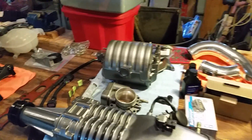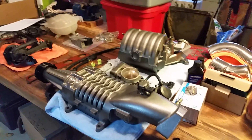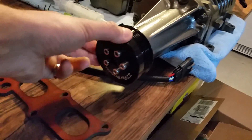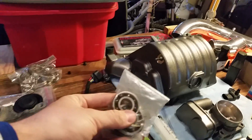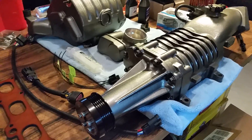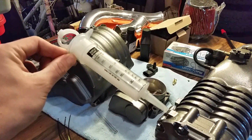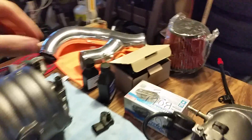Let's start with the obvious - the main part, which is the M62 supercharger. I got all this stuff for about $800 used, which isn't too bad, but bear in mind if you buy used you're probably going to have to refurbish a couple things. I have a 3.1 pulley from ZZ Performance, and while taking that off the shaft I figured I may as well redo the bearings inside. You can buy bearing kits for about $50 US - new bearing kit, new oil seals inside the supercharger snout. I also changed the oil inside, and the fill amount is 100 milliliters - that's what Eaton states.